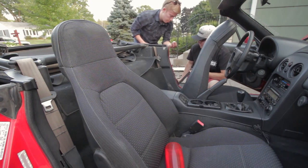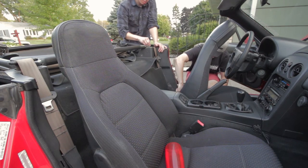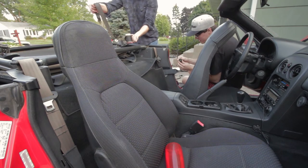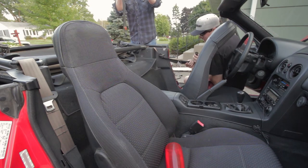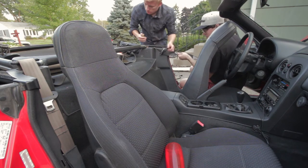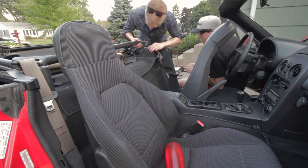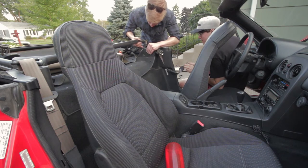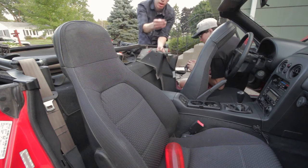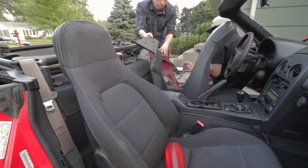So what size? The bottom one is a 17 millimeter. Top two bolts are 18 millimeters. This is disconnected. Here's our new seatbelt and retractor. When you crash, this will extend — so the old one doesn't have that, which means I need to get a non-airbag steering wheel. Just don't crash. Remember the order on this — there's a little tab here on the back that slides out so that you can get the seatbelt out from the plastic. Looks like there's two bolts to remove.